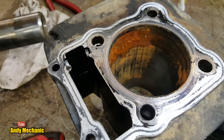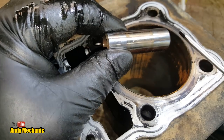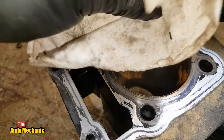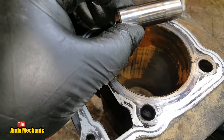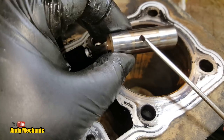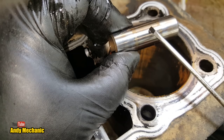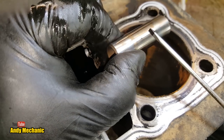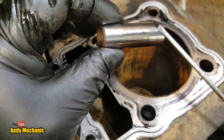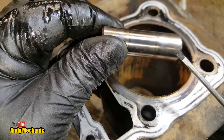Now, just while we're on with that piston, just going back before I put it in the parts box. Again, if there's been some scoring, sorry, never organised. You've got this section of the piston pin, or the gudgeon pin here, that runs in the little end on the conrod. And again, if there's been lack of lubrication, we'd often see marks and scoring around here. And there isn't any. It's all in really good condition. You can see there, look. So I'm very, very surprised.